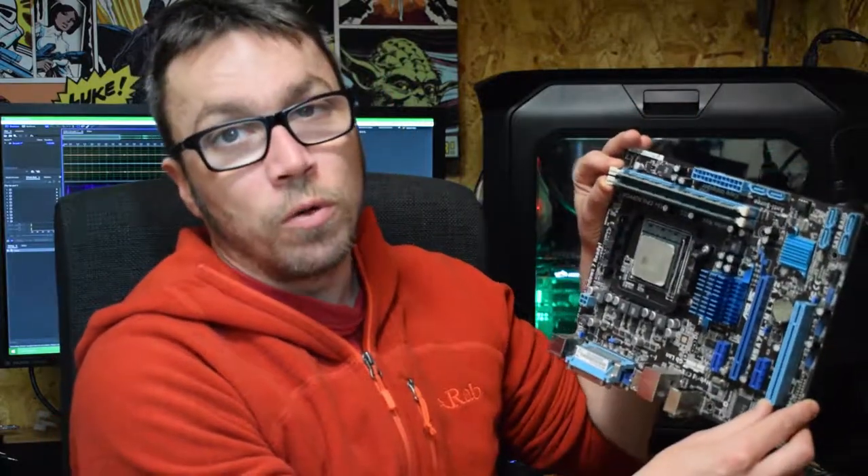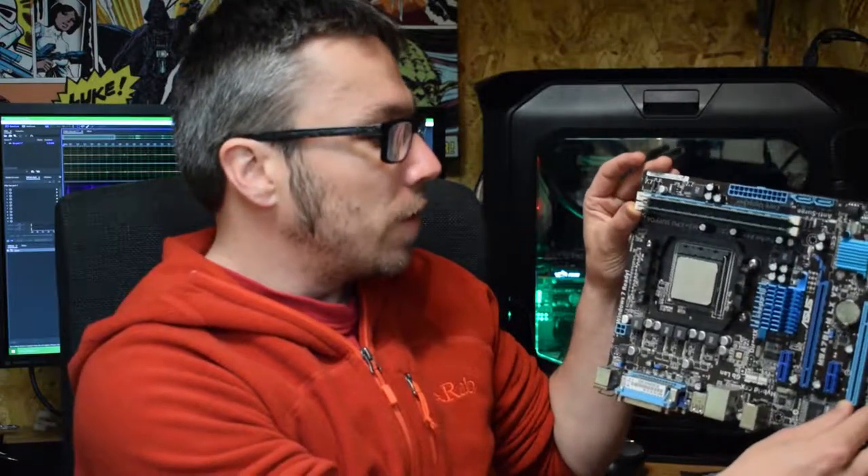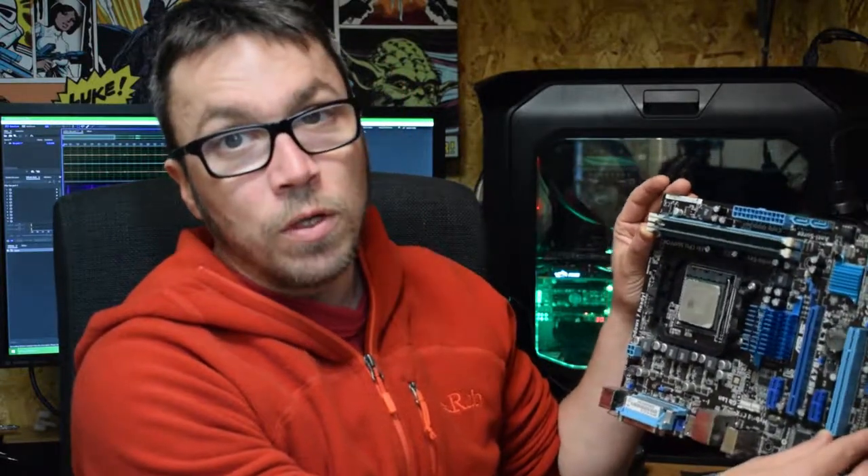It's not the best board in the world but it's okay — eight gigs of RAM in it, and more importantly there's an AMD FX 8120 in it. I know that's not the best chip in the world, but I think for a LAN box it'd be ideal. That board supports a mild overclock to around 3.94 GHz, which is fine for an FX 8120.